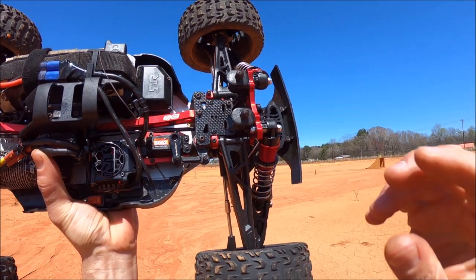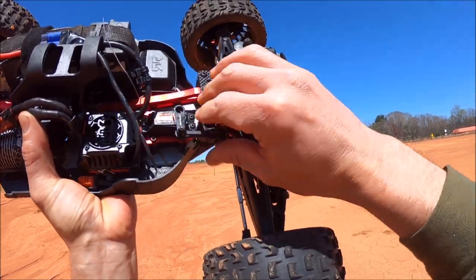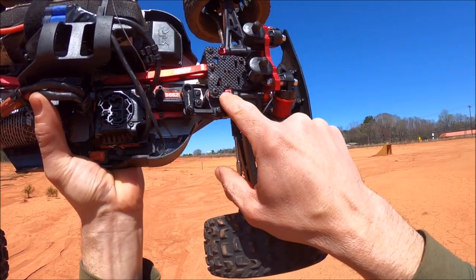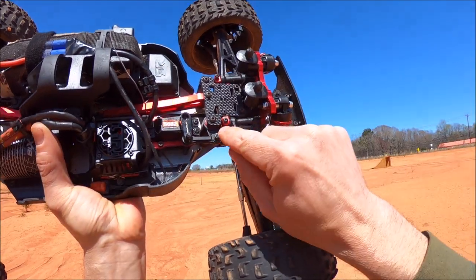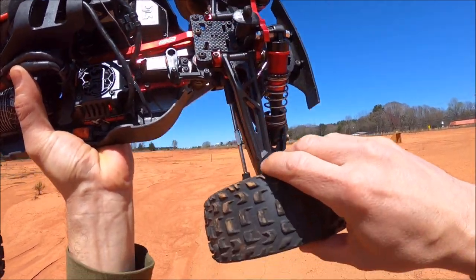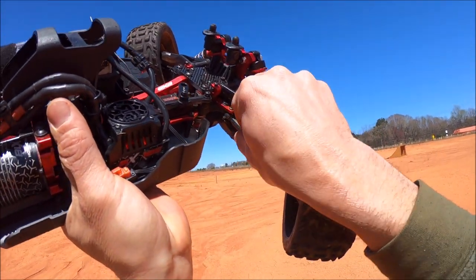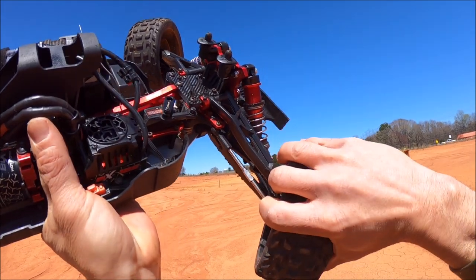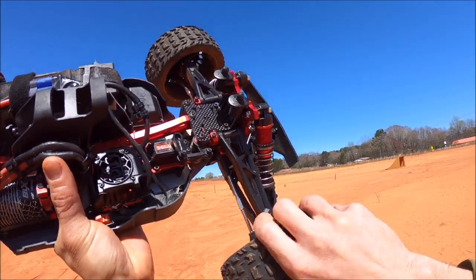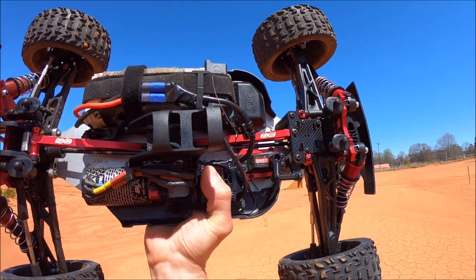I tried to do a video of this rig a couple of weeks ago but had a tremendous amount of play in my steering up here — a really loose bell crank. So what I did is I took out the brass bushings from the top and the bottom and replaced them with Jim's bearings, and also added a shim to the top of the post on each side. That locked everything down really nicely. I also have to make sure this little screw right here doesn't back out, or you'll get a ton of play in your Ackerman bar. All that's tightened down — not too tight, you want it to turn. I have a little bit of play in it, but it made a huge difference just switching out to the bearings and adding the shims.